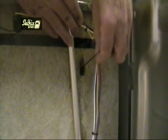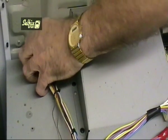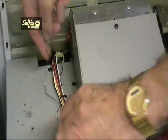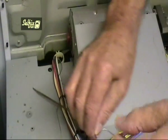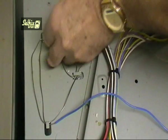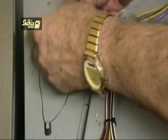If you're changing the thermostat because it's faulty or not working, then no special care need be taken in its removal. But if you're taking it out for any other reason, try not to bend the capillary tube too much or damage the phial in any way, or you may have to replace it. On twin oven cookers like this one, the thermostat capillary tubes tend to get entwined, so don't just pull it out of the wiring loom — even if you don't need it anymore — because you may just damage the other thermostat in the process. Take a note of which way around the capillary tube loops onto the little hooks and brackets in the cabinet for when it comes to replacing it.